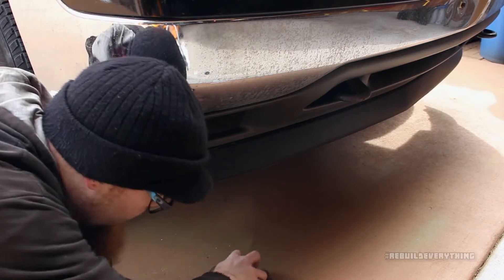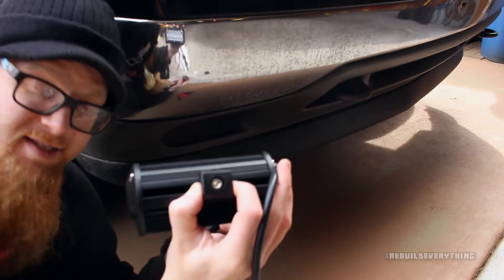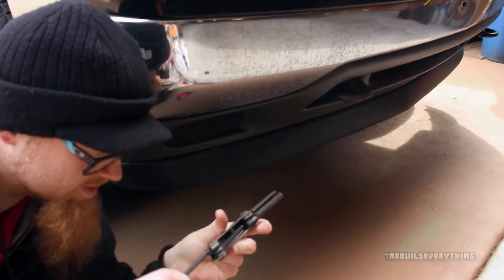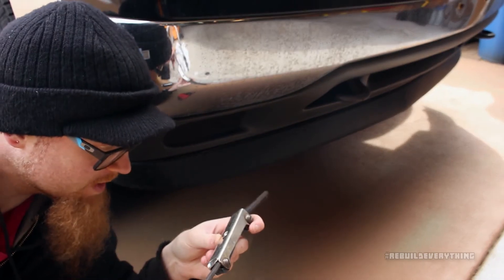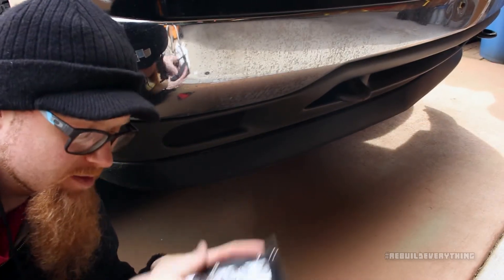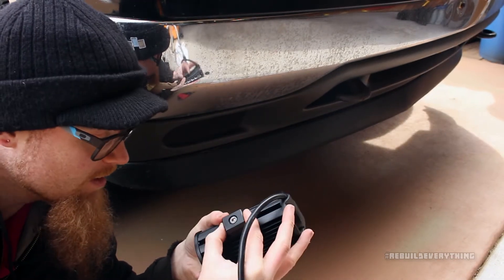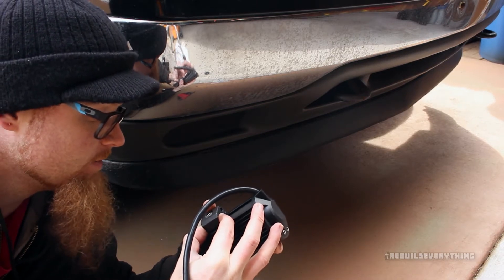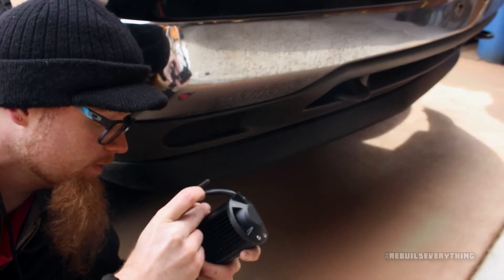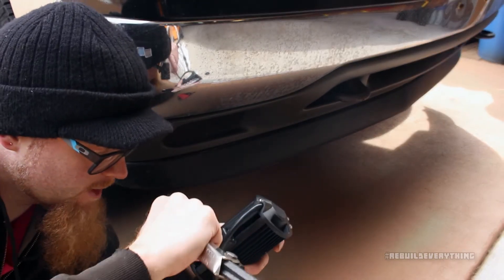Let me transition back over here. I got some Allen wrenches and I'm going to figure out what size this is. I've got a multi-key — probably an 8 millimeter is my guess. This thing definitely isn't new — Eklund Tool, Chicago, Illinois. I think this is probably from the mid-70s, since it was in my dad's box. Alright, so let's loosen this up here. Oh, it fits — so that's an 8. We're going to loosen it up just a little bit, and now you can see that slider freely travels left and right. So I'm going to center it right about there and go ahead and lock it in with that 8. Make sure to keep it level, because that's where those side screws have to attach.